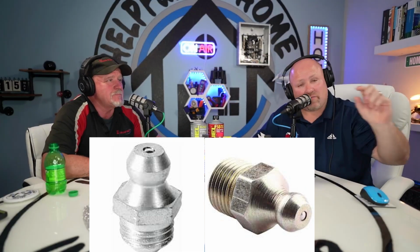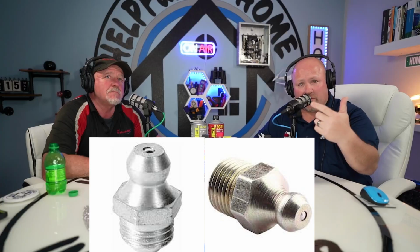Tammy will put a picture of a grease zerk on the screen for you in the replay here. You just stick the grease gun on there, make sure you seat it nice and tight, and then you give it a couple of pumps. And usually a couple of pumps is all you should need.